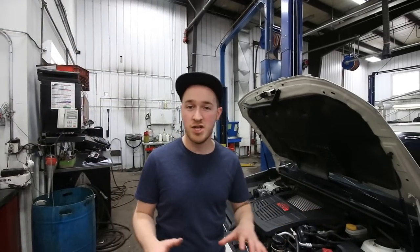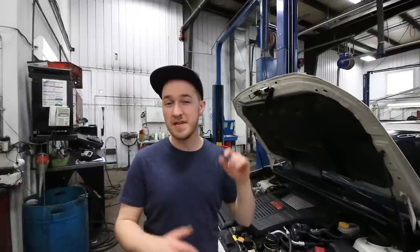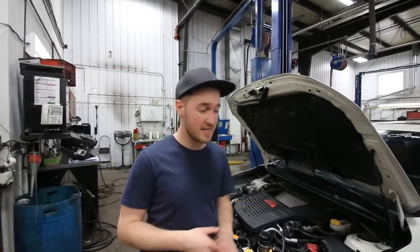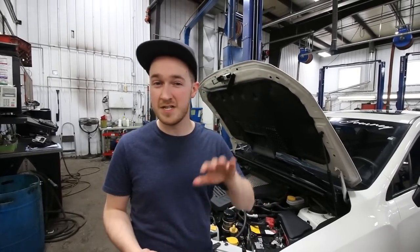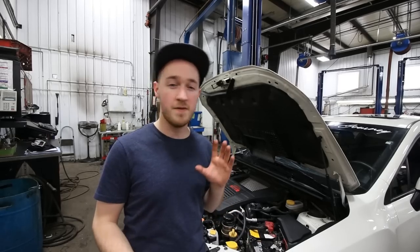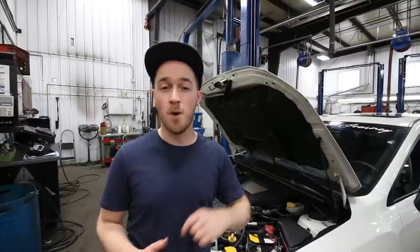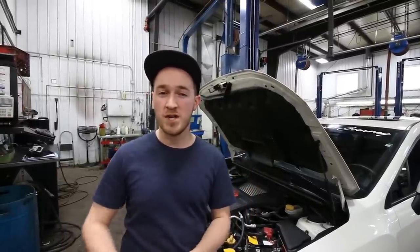Alright guys, so that's how to change your front transmission fluid and the rear differential fluids. I used the Motul Gear Oil 75W90 — I'll have links down below in the description. Don't forget to double-check and tighten your bolts to the proper torque specs, and once you're finished always double-check those levels. It's 3.3 liters in the front and 0.8 liters in the back, so make sure you look at the equivalent if you're in Canada or the US. If you guys have any questions, as always feel free to leave a comment down below. Thanks so much for watching and I hope you're having a great day or night, wherever you are.